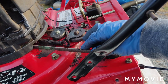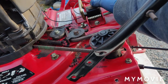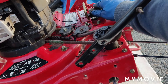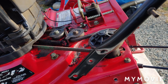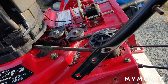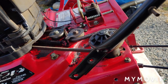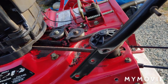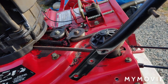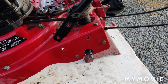I disconnected — took the spark plug boot off the spark plug wire. Even though I told you it has this safety over here so it won't start anyway, just to be safe, take the spark plug wire off. So I'm going to pull the power drive lever and spin it — and everything seems to be okay. The belt is on the pulleys and it's working nice. Now I have to hook up all the drive shaft power drive gears and the wheels.